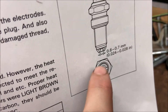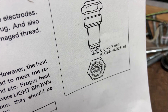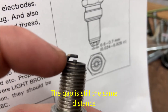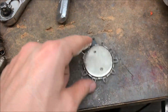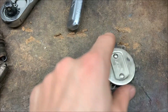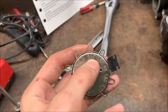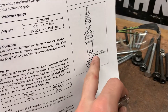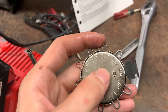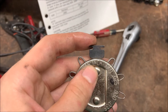You're also going to want to measure your spark plug's gap. This shows how you want your gap to be; however, you might not be using the original spark plugs, so you're going to have a slightly different gap — it acts the same way though. When measuring your spark plug's gap, you want to use a tool just like this. I have millimeters on one side and inches on the other side. I use 0.64 because it's in between 0.6 and 0.7 millimeters. You want to put this piece in between the gap and make sure that the gap itself is a reasonable degree. If it ends up being out of spec, you use this part over here to bend it to the correct spec.